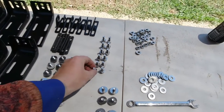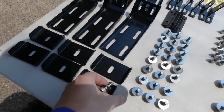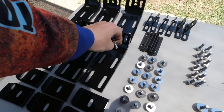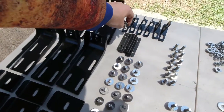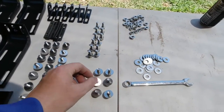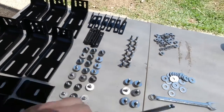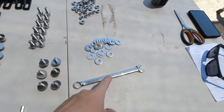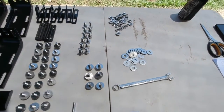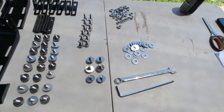The longer ones go through the cover plates on the outside, through the roof rack mount, through the roof mount, and into a nut. It does come with a decent quality 6mm Allen key, but didn't come with a spanner for the other side. I've actually got a 6mm Allen key bit on an electric Ryobi ratchet, so it should be a bit easier and quicker.